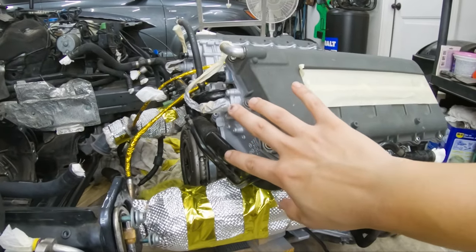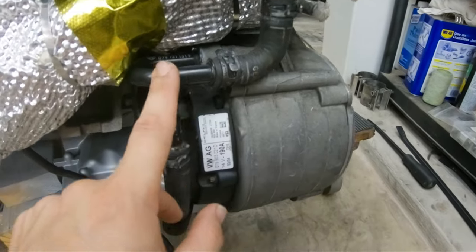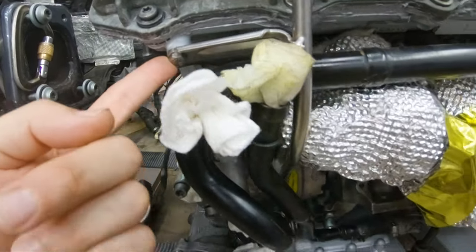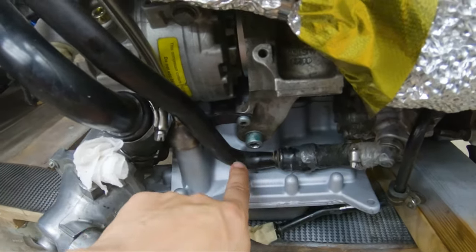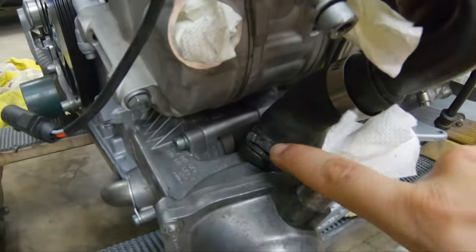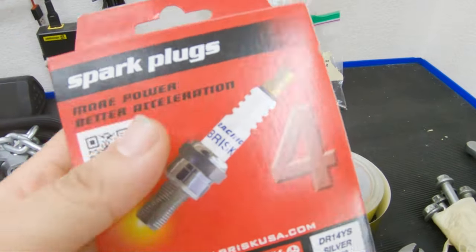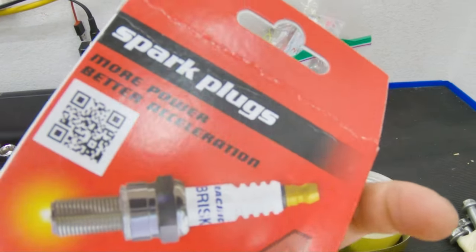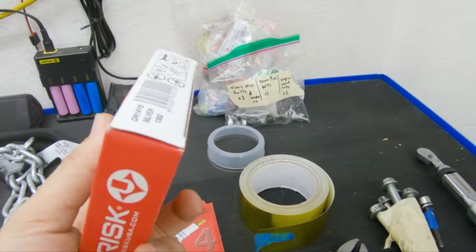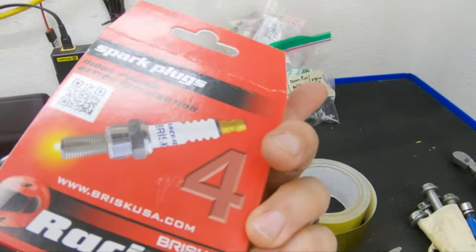I got the four screws torqued down in the rear. On the passenger side I got the screw connected and the coolant hose from the alternator connected. I was also finally able to connect the dipstick — there's a connection arm that goes to the block, and it goes down to the dipstick hole. Also connected the power steering line and the engine mount. I've also connected the hose from the water pump to the hard line. These are the spark plugs I'll be running — I got these from Summit Racing for boosted applications. If you're running naturally aspirated, OEM NGK spark plugs are just fine. There's no need to gap these, so I can just go ahead and torque them down.